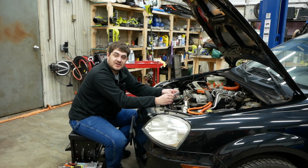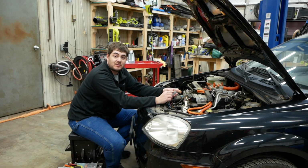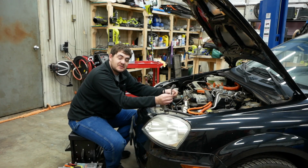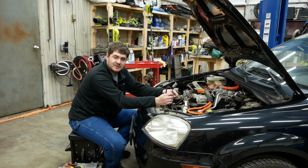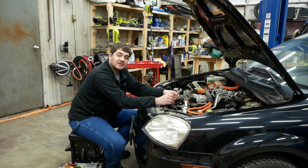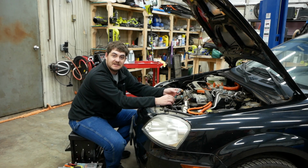During the couple of years this car served as a rather bland-looking driveway ornament, it was also serving as a hotel for rats. Mostly they just littered the car with rat sparkles in various places, but they also chewed through the wiring, right here, and possibly other places that I haven't seen yet. The previous owner told me that this harness goes to the water pump, or one of the water pumps. I don't remember if he said there were 1 or 2 water pumps. But anyway, when I plug up the car to charge the battery pack, it only charges up the battery pack by about 10% before the charger overheats. So it seems likely that there is something wrong with the coolant system, and it seems likely that this would be the culprit, since there's some wires that have been chewed through.